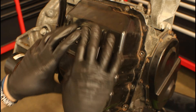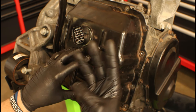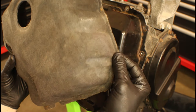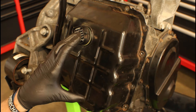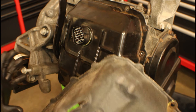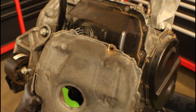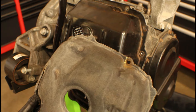Before installing all the bolts around the perimeter, remember we had two different types of bolts: some short eight-millimeter bolts, and then three ten-millimeter studded bolts that held the cover on. Check your cover to make sure it's not damaged — in a perfect world, reinstall it. But if the corners are messed up or it's falling apart, you can leave it off without causing issues with the transmission; a lot of it is just for sound deadening. But if everything is fine, go ahead and install it. Look around to identify where the three studded bolt locations are and install them accordingly.